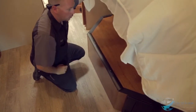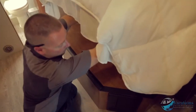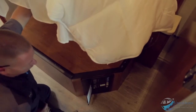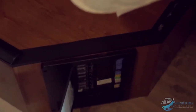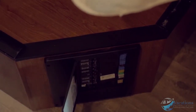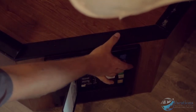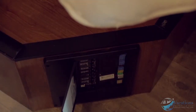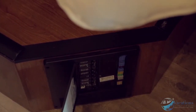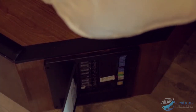You have a little bit of storage underneath the bunk. Right down here are all your fuses and breakers for the entire side of the coach — very important to know, because if your air conditioner isn't working it might have tripped a breaker just like at a house. On this side you've got all fuses for the 12-volt side — for lights, bed lifts, radios, and similar items. If those blow, just pull it out and replace with a new one.